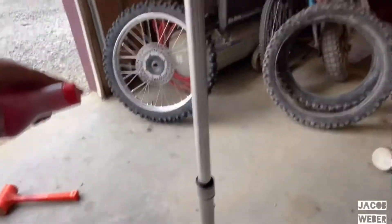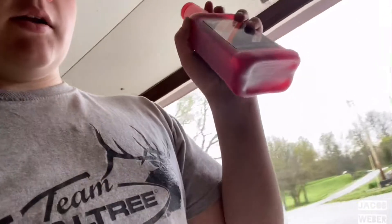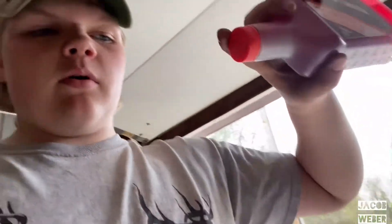I've been at it for a while now. I have the fork here — I took it apart, cleaned it, drained it, and put the new seal on. It's ready for new oil. I've got it sitting upright with a funnel, and it says 12.6 ounces, so I'm going to pour the oil in, then put it back on the bike, put the front wheel on, and get started on the handlebars.